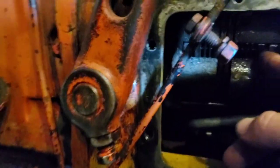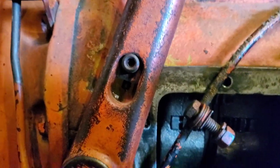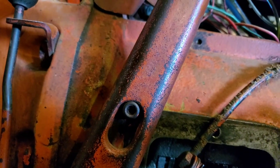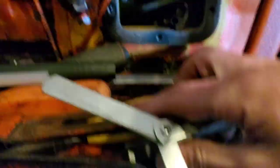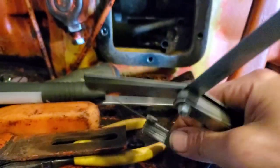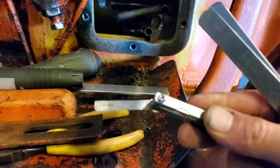So basically this can go down to 55 thousandths before the clutch needs to be rebuilt, just using common sense. The first thing we've got to do is get this measured. How I did it — you can see I had some numbers here because I already did the first one to give myself a good idea of what feeler gauges I needed. I ended up just using two different feeler gauges and it worked out really well.